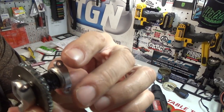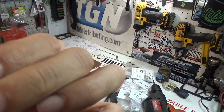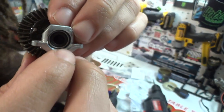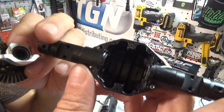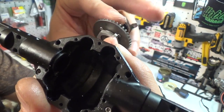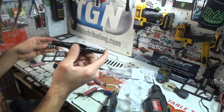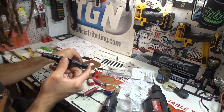What I figured out was these little bearing carriers right here - the inside groove was not machined out where it needed to be. There's a lip right here, and this outer lip wasn't deep enough. When it would go in, you see how the tubes slide in and appear on the inside - that part of the tube sits inside that lip. It wasn't machined down enough, so it was sitting on top of the tube, which was lifting up the entire pumpkin housing.